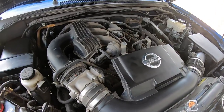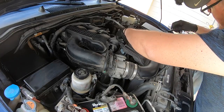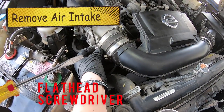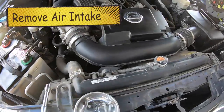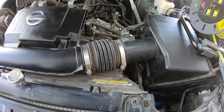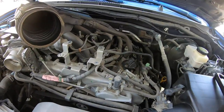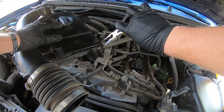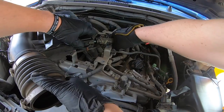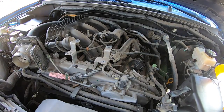Set that aside. Then we have two little screws — same thing, 10 millimeter — just go ahead and ratchet those right off. They're pretty small, so take your time. Next, remove the air intake using a flathead to untighten the little screws on each side. It's nice that it has flexi tubes because they pull off pretty easy. Then use needle nose pliers to pull the vacuum line off — once you slide it down it should come out pretty easy, though you could probably get it with your fingers, which is why I put it as optional.